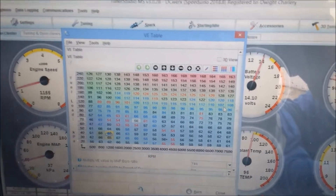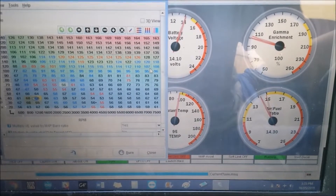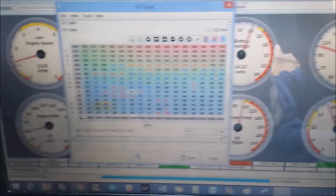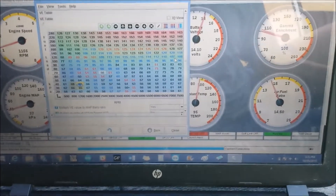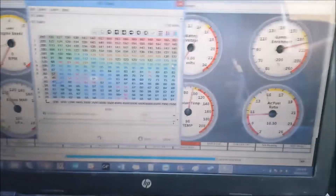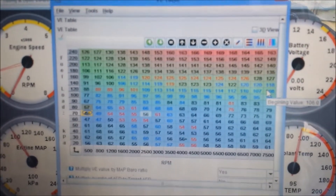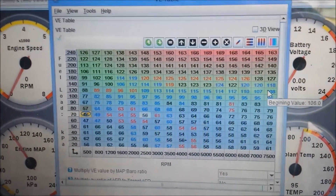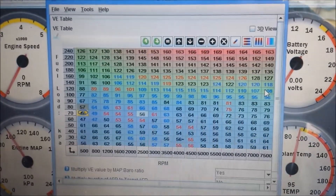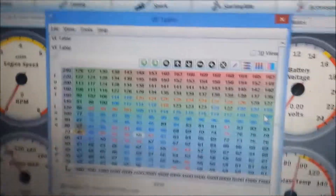This is the result of the table after a little tune-in. We have the car idling somewhere around 14.4, getting pretty good vacuum. So this is the fuel map — you can see some blue and yellow over the map. Blue indicates places where the autotune added fuel to the fuel map, and red would be where it reduced the fuel map. These are the changes it made. It didn't make too many changes.